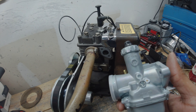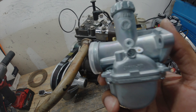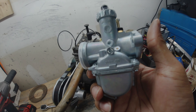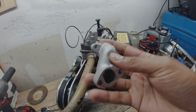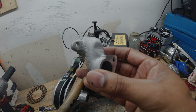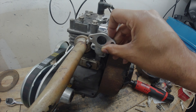Even though it says Mikuni, you can't get an authentic Mikuni for $35. We have an authentic Chukuni, aka a Chinese Mikuni. We're going to fit this onto the block using a Tecumseh $12 intake manifold attachment that I got off eBay. I think this is going to be the ticket — it literally lines up perfect with the ports.